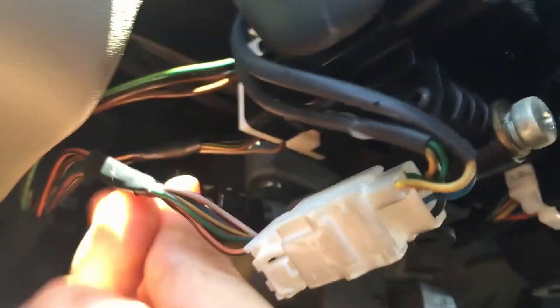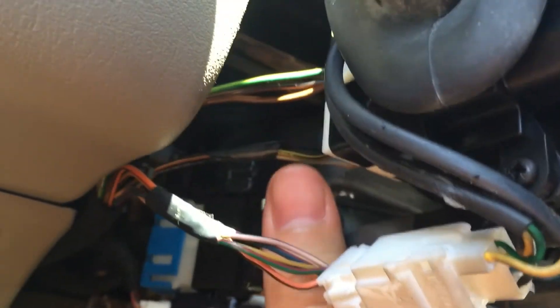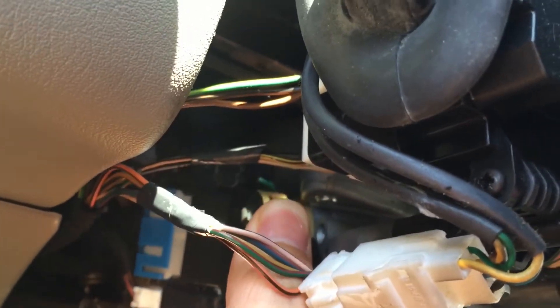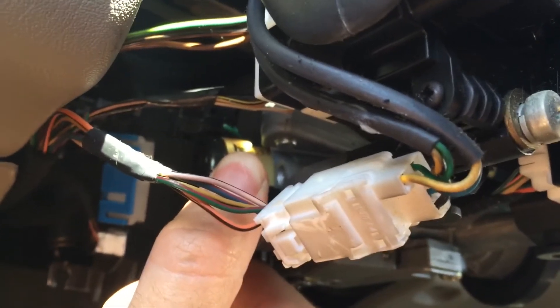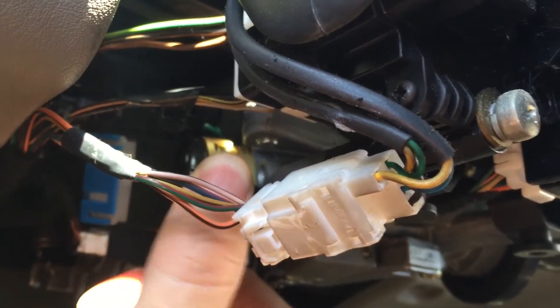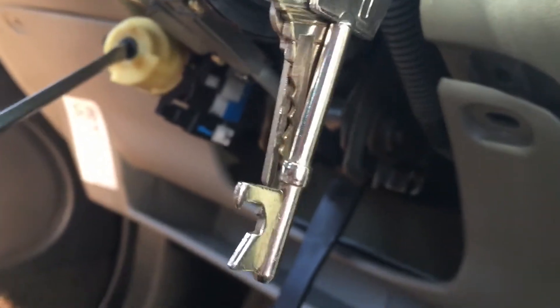I think that's probably the right amount it's supposed to turn. However, a temp fix that people use is if they slide this down and try to start it, it actually makes up the difference and will engage the ignition switch. I've been starting the car just by putting the key in, having it on position one, and starting it.